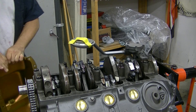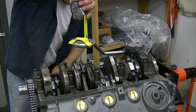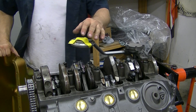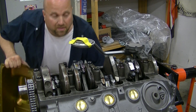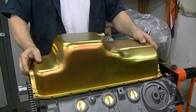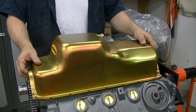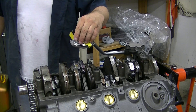So what I did was I taped a nut — which is about a half inch — on the end of this pickup. So what I would get was, when I put this pan on, I could push this down and then stop, and I know that pickup's going to be approximately about a half inch from the bottom.